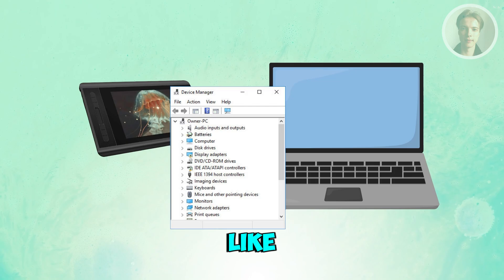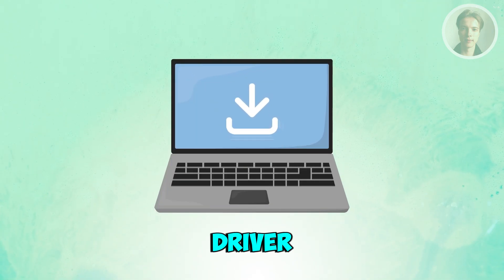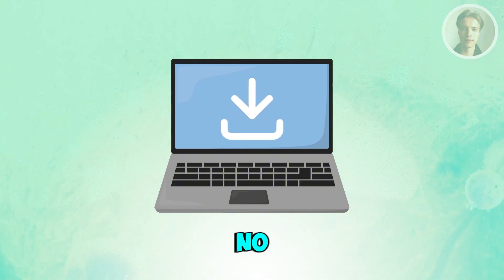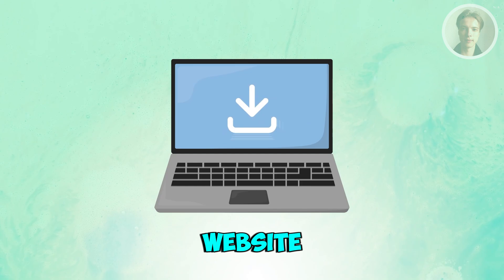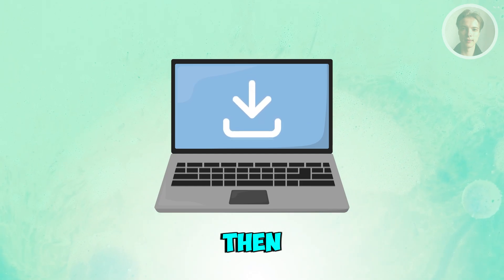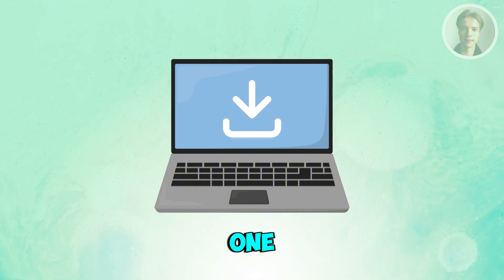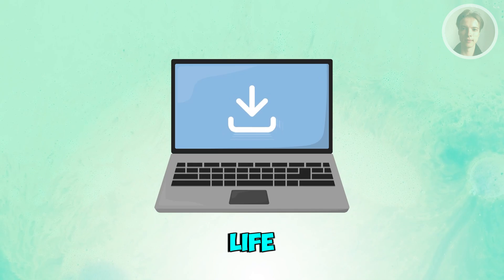Speaking of drivers, you may want to update or reinstall the XP-Pen driver. A corrupt driver can cause no signal even if the cables are fine. Go to the XP-Pen website, download your exact model's driver, uninstall the old driver, restart, and install the new one. Once the driver is fresh, the tablet often comes back to life instantly.